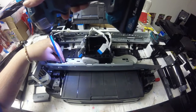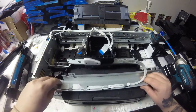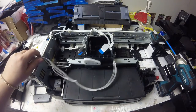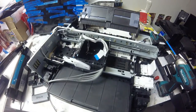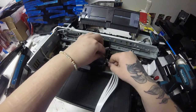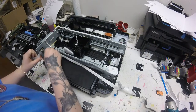This is a printer that I was taking apart for parts and I had decided that I was just going to use these FFC cables and replace them in the other printer. I'm going to work on taking off that bottom rail again and taking off this bundle of FFC cables and replacing it with the other one. Before we go any further, if you do know how to take the case off and the scanner off, I'm going to put a link to the video above. As I was doing all of this, I tried to keep the FFC cable bundles mostly in the same orientation. The FFC bundle has this little double-sided tape that holds it together, so I tried not to pull that apart when I took it out and switched it over.